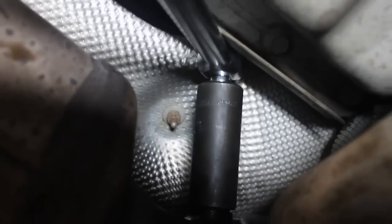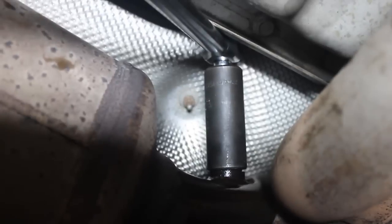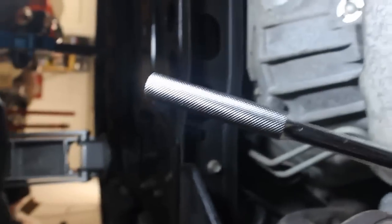Here's a view of the passenger side connector from the rear — it is extremely accessible, so we'll be able to reach right back there and unclip that connector. And here we've arrived at the most challenging part of the task, and that is getting that O2 sensor loose. I mentioned the first step before we worked on the wiring was to spray some liquid wrench on there — that always helps. Some people recommend warming up your car; your catalytic converter and all that will get very warm, which might help get that out of there. For me, I just used a socket with a one-foot breaker bar, and that proved to be up to the task with a little bit of elbow grease.